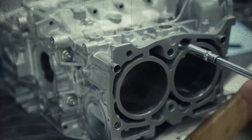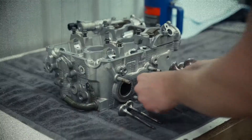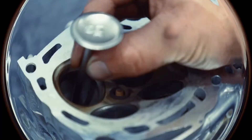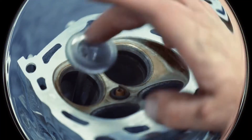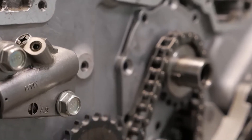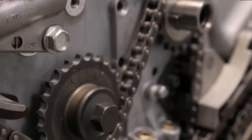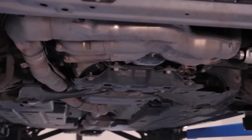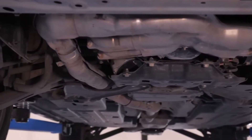Additionally, the fuel injection system was upgraded, with injectors relocated to the cylinder heads, improving efficiency and enhancing airflow through redesigned intake and exhaust ports. The engine also uses a maintenance-free timing chain and features a retuned exhaust system with improved manifolds and optimized pipe diameters for better catalytic converter warm-up and overall performance.